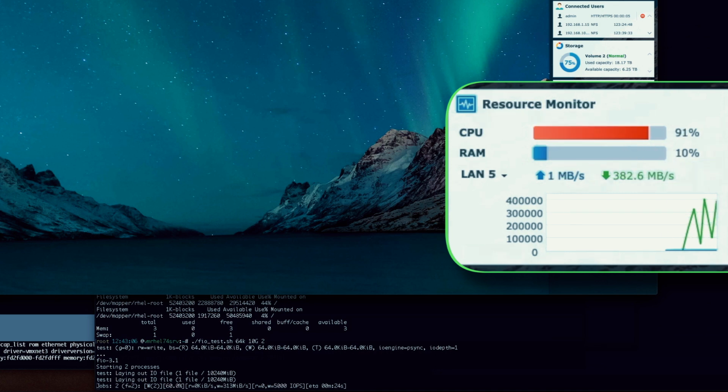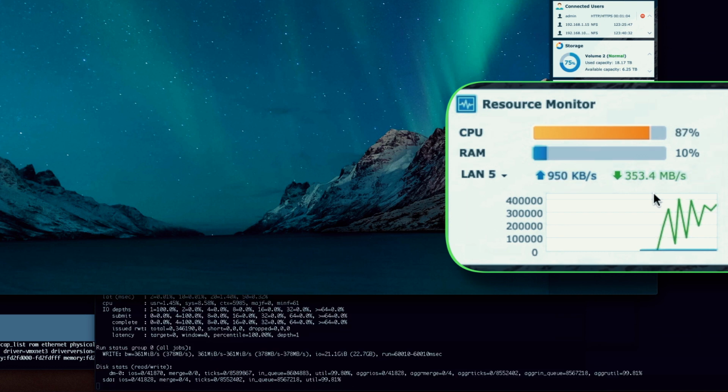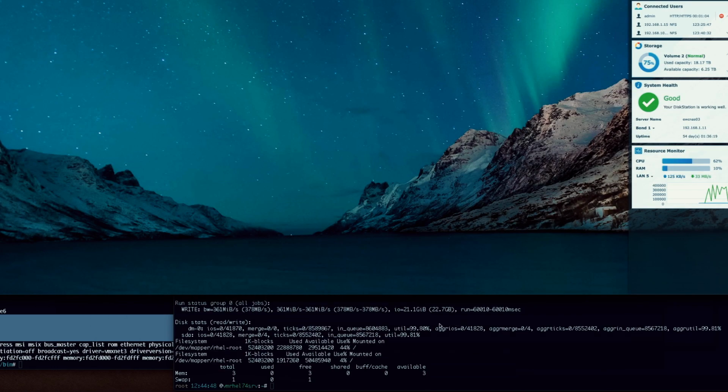But again, that throughput also depends on the configuration of your Synology NAS. If you have an SSD cache, that performance should be higher, because we can drive more on that. And I'm going to show you another test, which will test the network cards themselves, what they can drive on the performance, and we will see how that differs between PCI version 1, PCI version 2 and PCI version 3, to see what kind of configuration you would need to keep in mind when you're installing the cards inside your system, so it will use the proper generation of PCI.